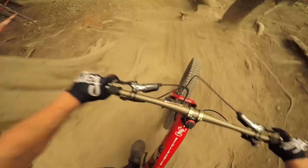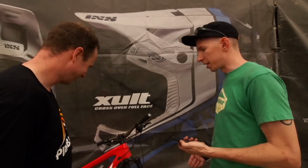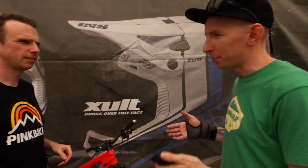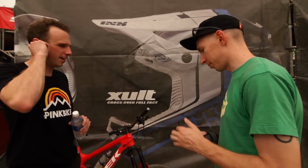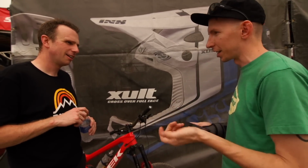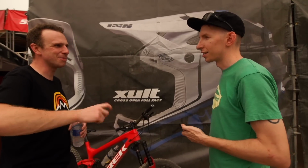So your rear shock suggestions. It's got a few things, and basically it thinks you could have more compression now, but there's no way to adjust that. This shock is a little different because of the way the reactive valve works, so it might not quite work with ShockWiz. There are a few different things it's doing compared to a standard shock. It says you could speed your rebound up a little bit, but we only did a click, so now we're going in between settings. That's funny, because I was always like, just one in between would be great.